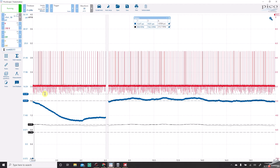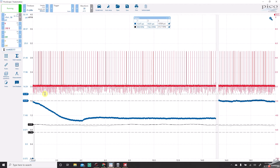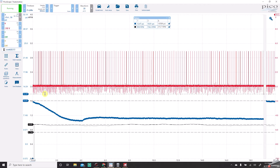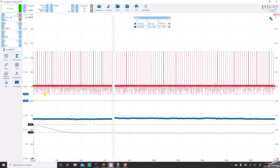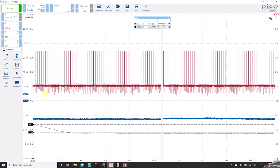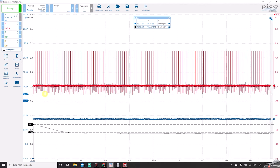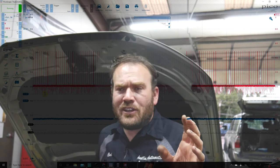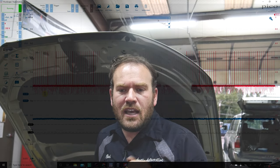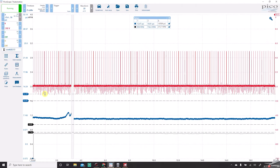Plugging the port — our RPMs dropped a little bit and we are down to 12 and a half inches of vacuum, and we can see that my oil pressure dropped drastically. Now that RPMs have dropped we're much closer to that lower RPM. If we compare this pressure to the value when I gave it the large vacuum leak in the crankcase — if our RPMs are the same — we can use those two pressures to calculate the difference. We're still at about negative 12 and a half inches, so roughly negative 6 psi. If I jump up approximately 6 psi when I release vacuum in the crankcase, then I think my theory is correct — it's just a pressure differential.